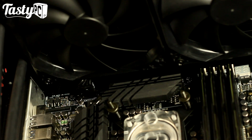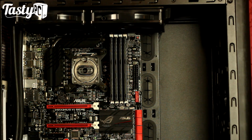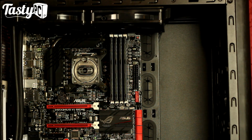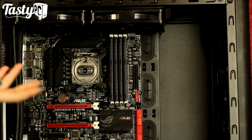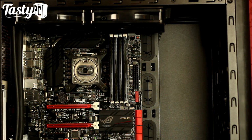And you can only come down to where your memory starts, and there's roughly 65mm space between the roof of the case and where your memory starts, meaning that you can only really fit like a 30mm thick rad with a single set of fans. So even though it is possible to fit an H110 rad in the roof of the Arc Mini R2 with the optical bays removed, you do have to be very careful, like I said, with the motherboard CPU cable.